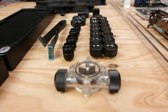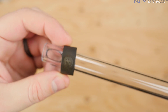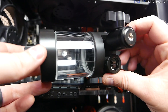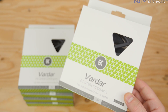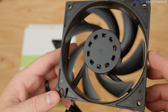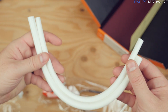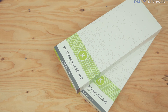Additional fittings include extenders, a ball valve for a shutoff to use as a fill port and drain port, angled fittings, and rotary fittings. For airflow over the radiators I have five EK Vardar F4 120 2200 RPM fans — two for each radiator plus one exhaust at the back. I also got the EK DIY kit, which includes a saw for cutting PETG tubing and the silicone inserts you need to put inside the tubing before bending — essential for getting clean bends with the right-sized insert.